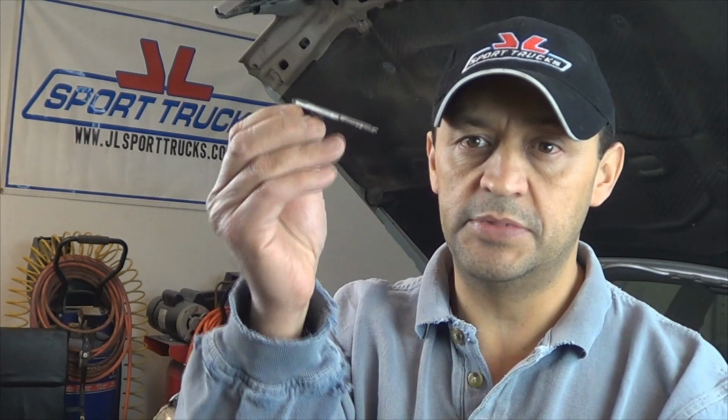If your battery is totally dead, you're not going to be able to unlock your car with your remote control. So you're going to have to use your emergency key to unlock the door and open the hood, because even the trunk cannot be unlocked with this key. And as you know, or even if you don't know, the battery for this car is located in the trunk. So it's necessary to open the trunk to disconnect the negative battery cable when replacing the alternator. Plus, you're going to have to charge the battery anyways.